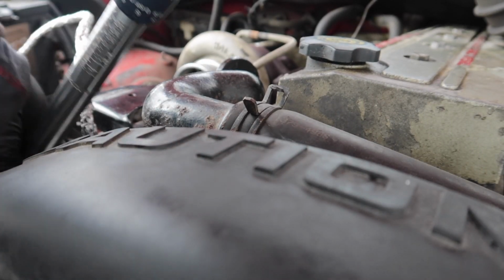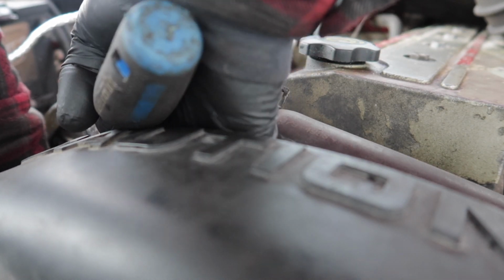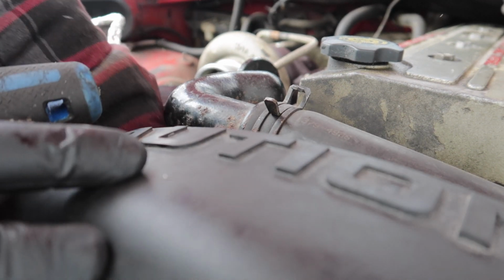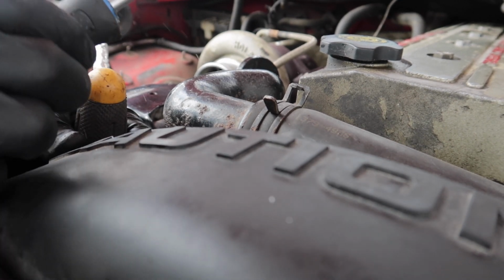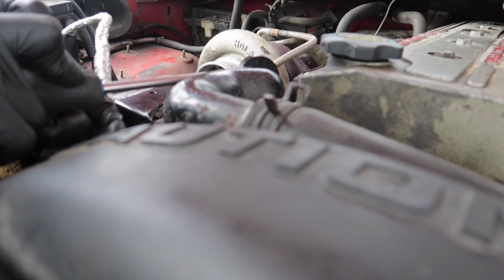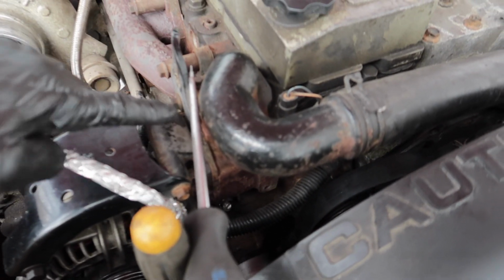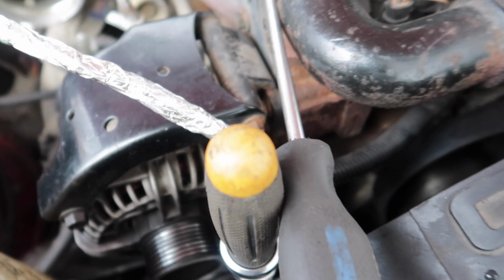So put your ratchet back on your tensioner. Alright, so once you have it on your tensioner, grab it again, pull that tensioner up. You'll see the top of my ratchet here, or my torque wrench, goes like this. Take your screwdriver, you put it between your thermostat housing here and your lifting eye, and it'll rest right in there. Show you here. So there you go. You wedge that between here and here. If you've got a screwdriver that's got a grip like this, that's best because it'll hold your wrench in there.